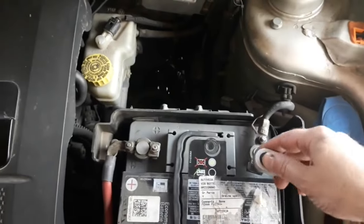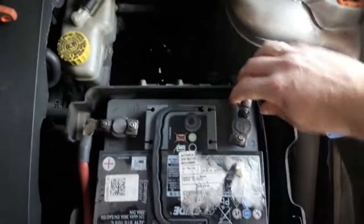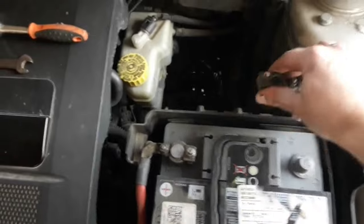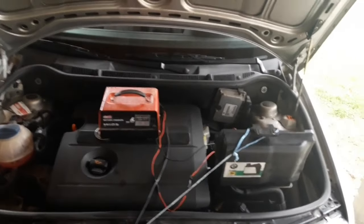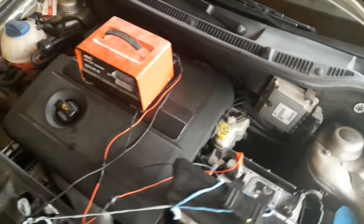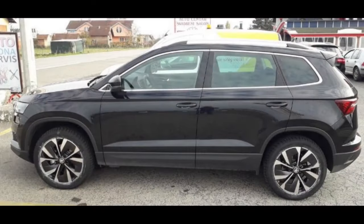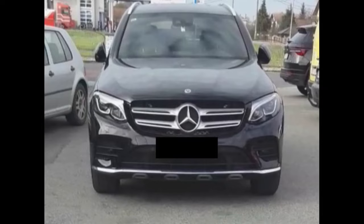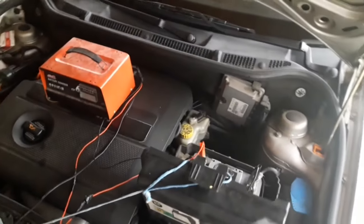Note that you can take off the minus battery clamp before connecting the charger — this is safer for your car's electric and electronic installation, but you'll lose things like the radio code and you'll have to set the clock again. I've done this numerous times on various older cars from the 2000s and there were no problems whatsoever. However, I wouldn't recommend recharging the battery this way on high-tech cars of the latest generation, as there might be consequences due to complicated electronic systems. If you have any doubts, best take the battery off and charge it, or even better, replace it completely.